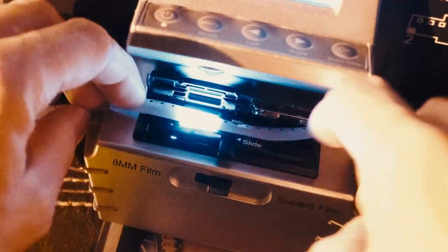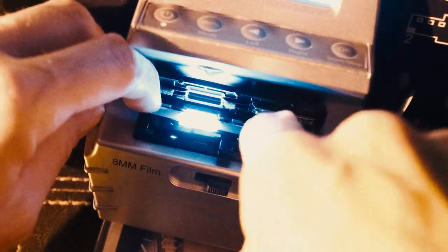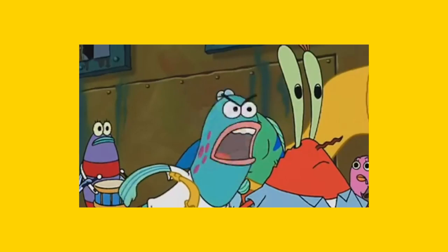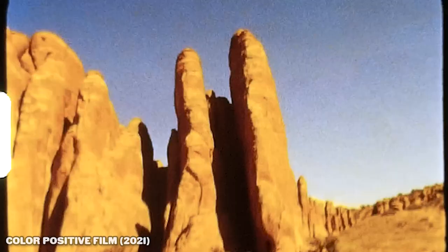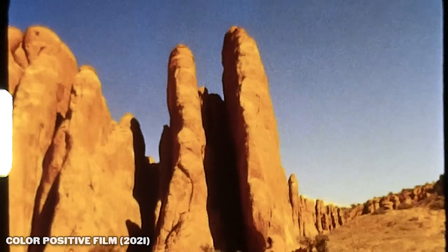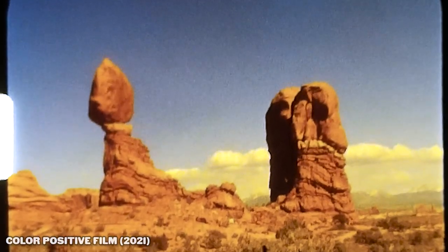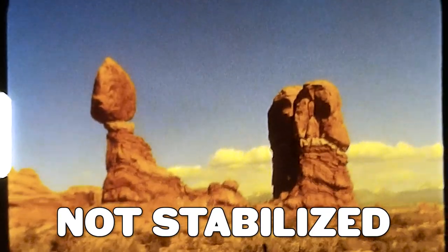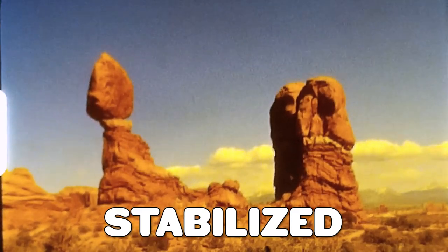I don't have a ton of experience with 8mm and Super 8mm scanners, but on this unit the little clips that you thread the film under are just not the best in terms of design — especially when you have big meaty claws! They're definitely fiddly, but more importantly they don't seem to hold the film down securely enough. I feel like the film manages to wiggle a little bit as it's scanning through, and as a result you start to see something similar to gate weave. If you crop your footage in a little bit and add a stabilizer it can kind of combat the issue, but it seems to pop up a lot more on Super 8 as opposed to just 8mm.